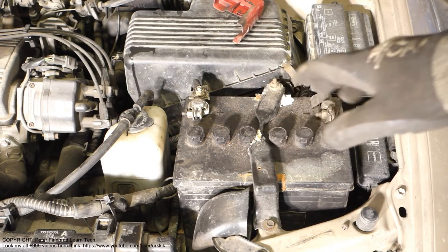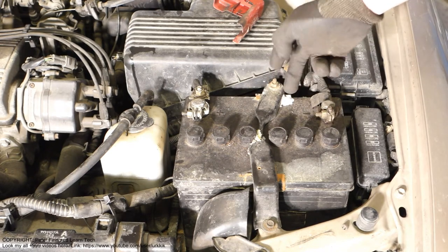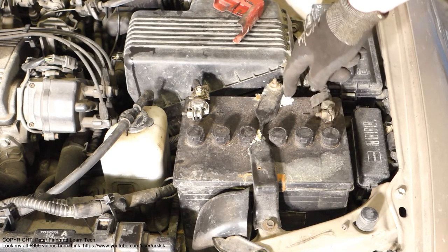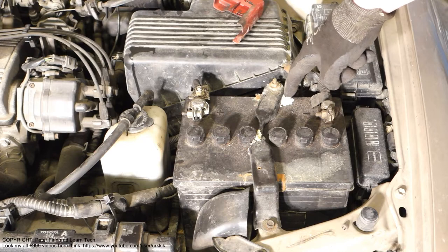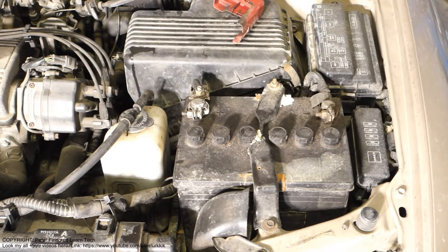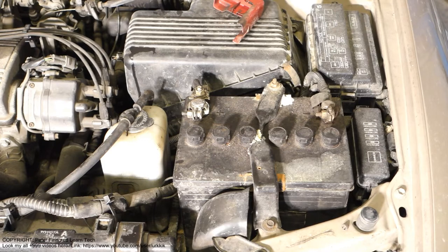And it's so important to remove all of this corrosion, because it spreads and moves like cancer. When we have one corrosion in here, quite soon it is in here and in here, and then we have difficulties starting our car. Next I'll show how to remove this corrosion and how to lubricate these terminal bases. Okay, and then we continue.